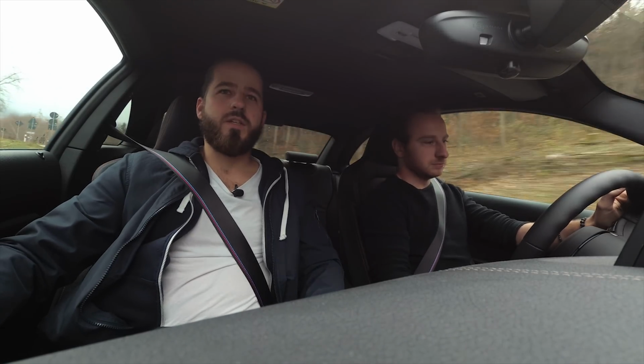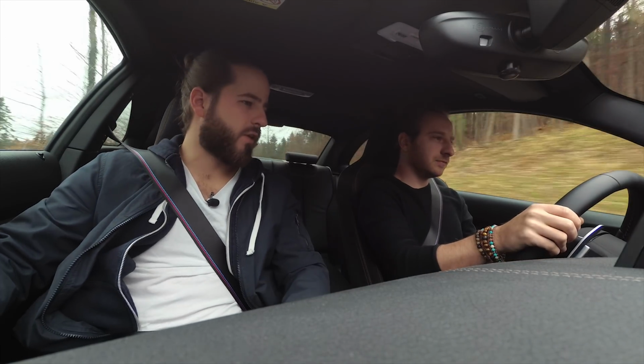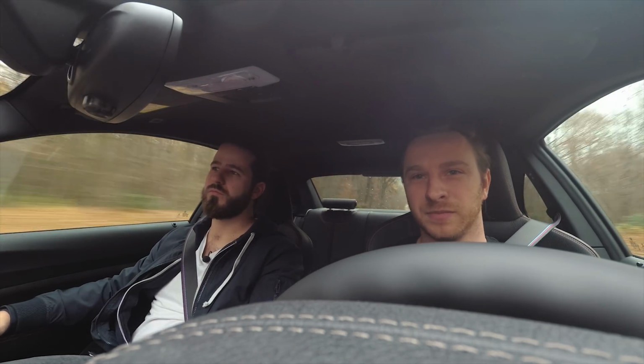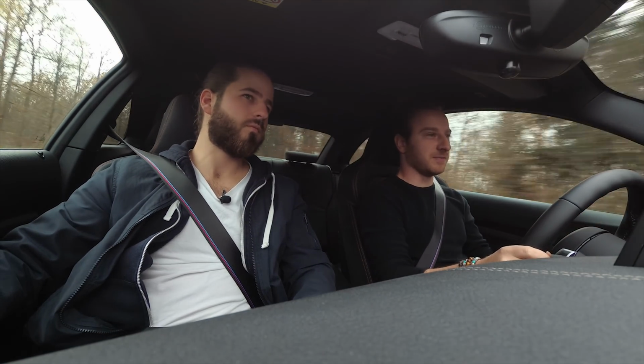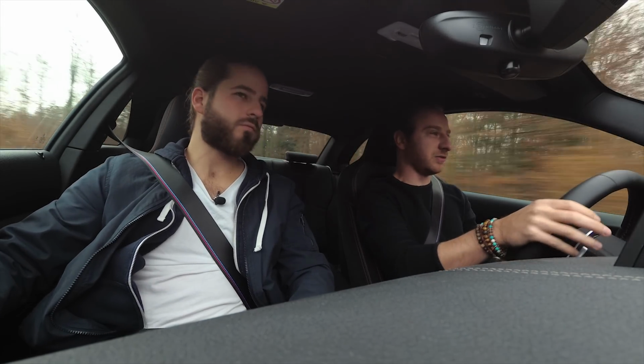Okay guys, so as you can see, we're sitting in the M2 competition and we're on the road. I set the car back to stock settings, and Dani, you drove the car for a few days already with tuning and without. So maybe you can tell us a little bit about the car in stock, how it behaves, where it performs quite good and where it's maybe missing a little bit. So the car feels great overall, but there is one thing I dislike a little bit. Basically the power drops off after 5000 RPM, and that is basically what we saw on the dyno as well, that it's kind of restricted above 5000 RPM, and that was also the main target in the development process, to get rid of that, so the car keeps pushing until red line.